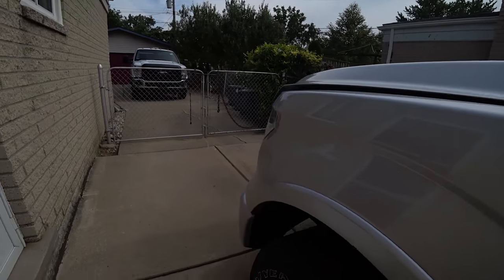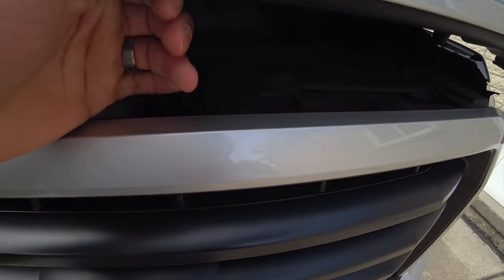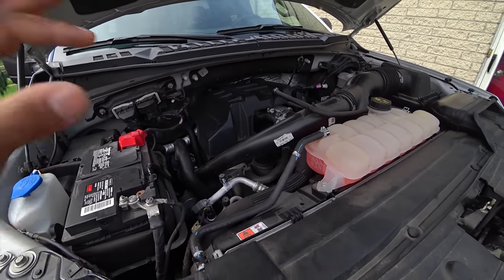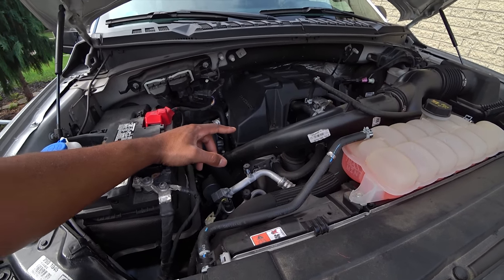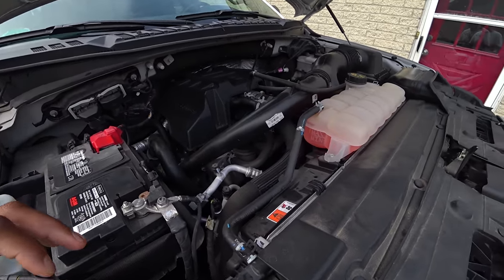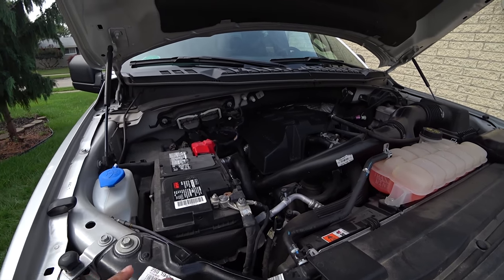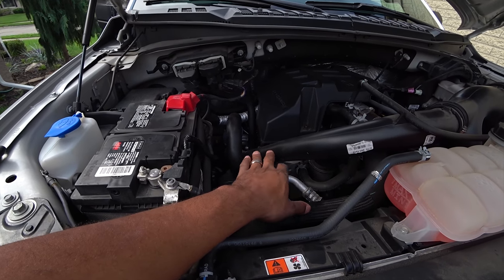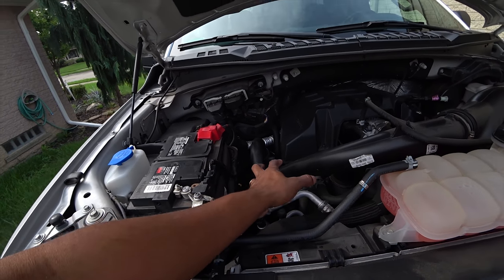The main feature of this truck is the engine. It's a dual overhead cam with dual overhead variable valve timing. Both the intake and exhaust camshafts are variable, so as it goes through the RPM band, the intake and exhaust both have cam phasors which can adjust in real time to give you the best performance — cool technology. It also has integrated exhaust manifolds which are water-cooled, and the turbos are water-cooled as well, mounted right to the heads.